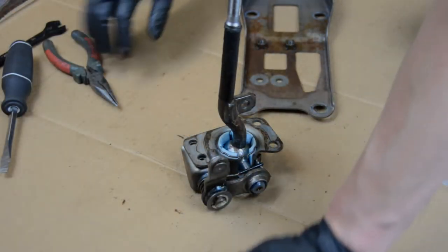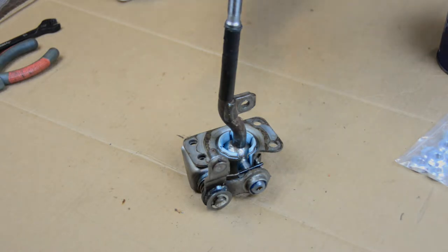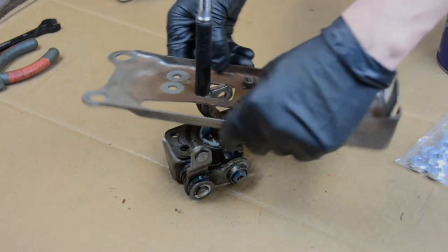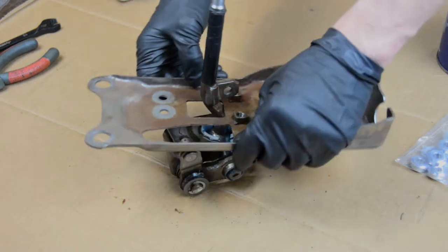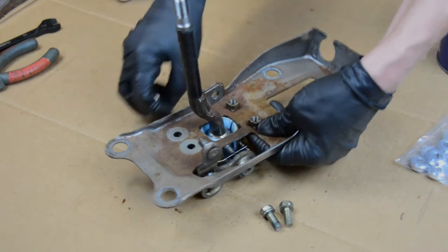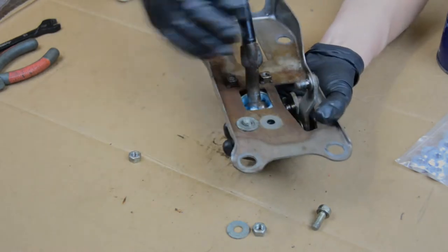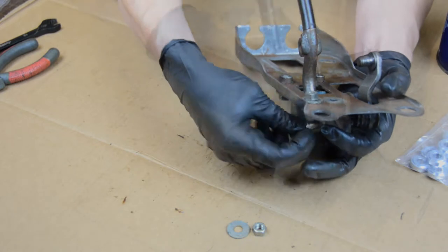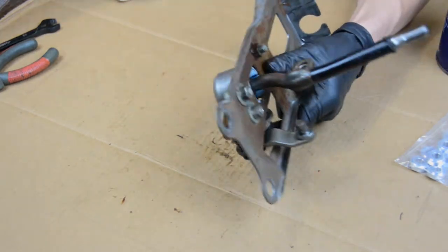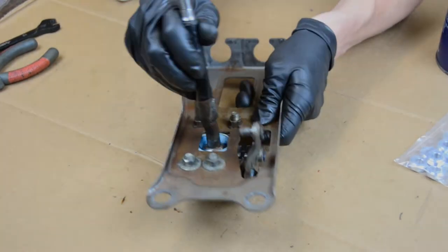New shifter cup installed. Let's get this assembly back together. I've decided I'm not going to do the short shifter right now - I just kind of don't want to mess with it. This does go in one way - the little armature thing sort of sticks to the front of the car, and you do have to weasel it around that little bracket to get everything to sit happy. Same length bolts front and rear, but one has a nut on one side and one does not. Get them all started before you tighten any of them down.